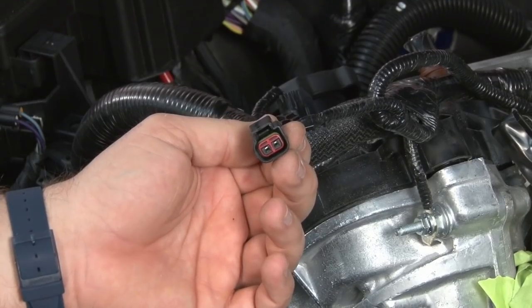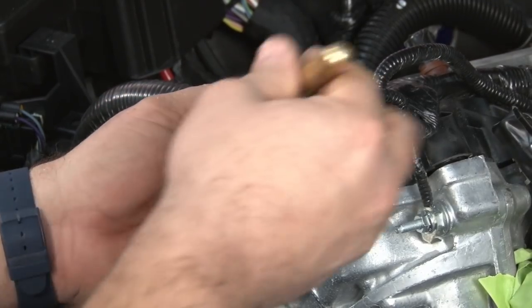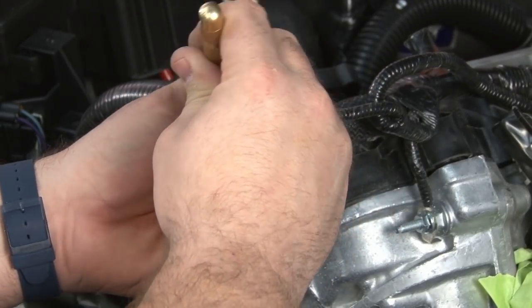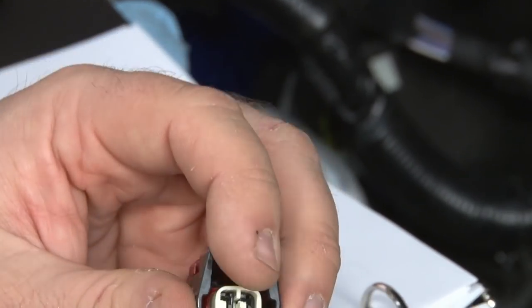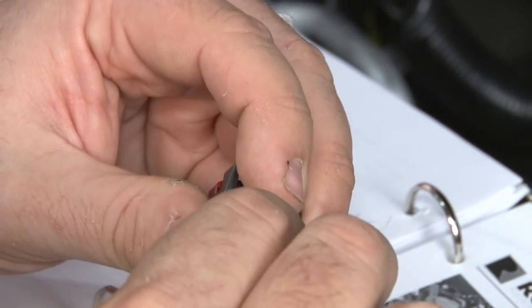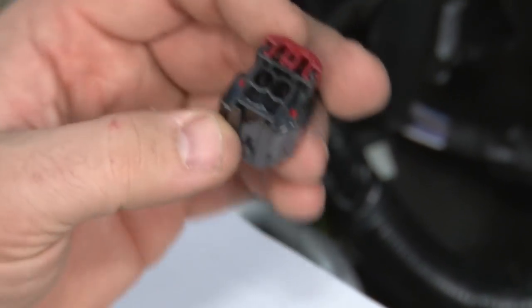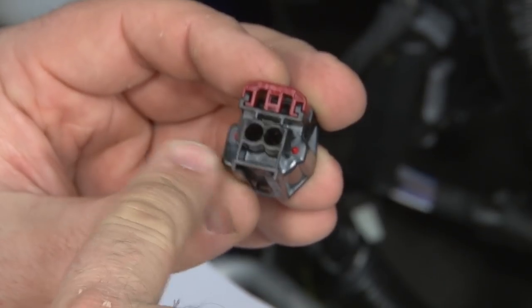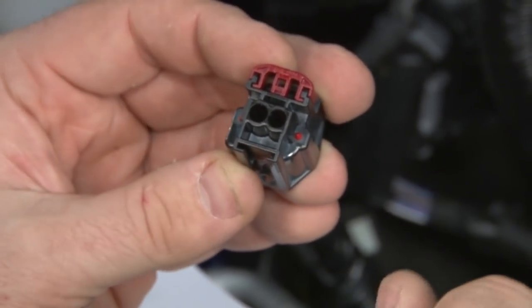Next, we're going to modify the purge valve wiring harness. Same process, pop off the centerpiece and D-pin. I'll grab the new empty plug that's included with the wiring. Carefully pop off this white insert. Now we'll take the wires we just removed and install them in this plug. Again, you've got pin position 1 and pin position 2. The instructions tell you which wire goes where.